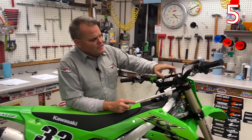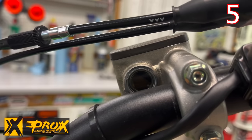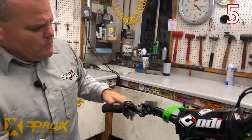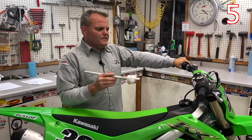Also on brand new dirt bikes, you can even see the color right here. This bike's got less than 15 hours on it and the color of the fluid is already a bit burnt looking. We noticed this and would change out these fluids within the first 20 hours. I don't think there's any problem with running it the way it is, but that's something I would do.